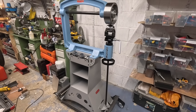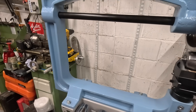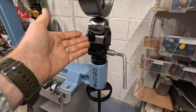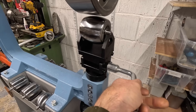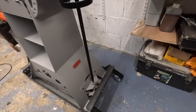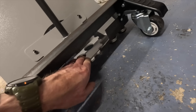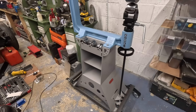Here it is — the English Wheel is now all set up, and behind it as you can see is the space where it's going to go. I've had to add this rod and foot wheel which is used to lift and lower the bottom wheel, but it's also got this quick-release drop mechanism so you can change the bottom wheel without rolling it down. I was right about being wrong about this piece — I did have to cut it out — but that's absolutely fine. The top bit gives it all the rigidity so I've got no qualms about that at all.